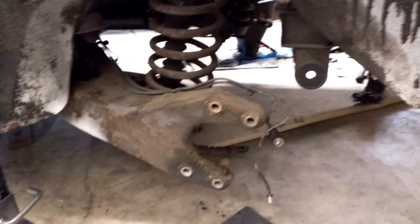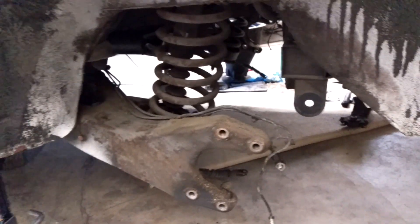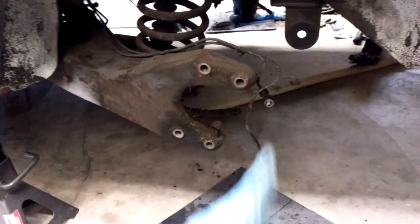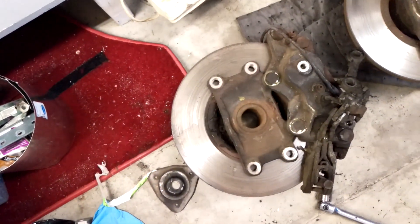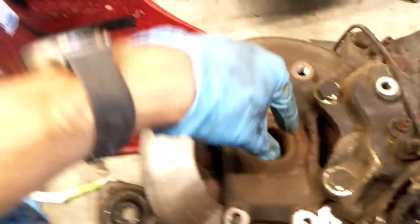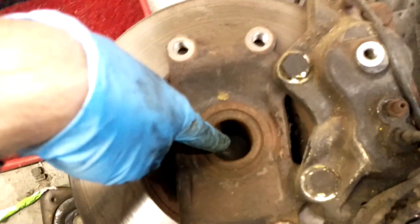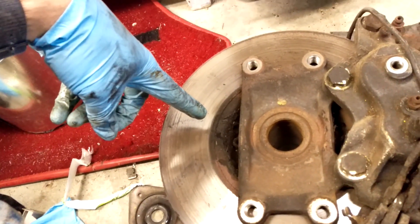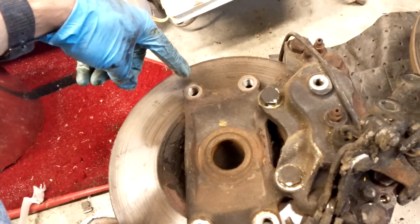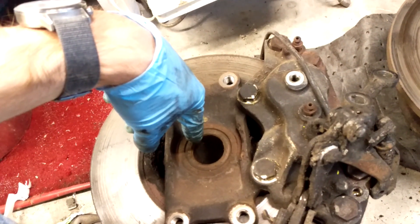I have the hubs taken off right now because I'm having the drive shaft machined for two extra woodruff keys, otherwise a single woodruff key is attempting to transmit all the power. There are the twin brake lines, and obviously the diff would mount to that giant carrier. Here are the hubs — brake calipers still attached. The yoke comes off for the U-joint, goes all the way through the hub, then bolts on with a crown-looking thing back onto the brake rotor and the face that holds the wheel with the studs. A crazy arrangement — all these beefy components and just one woodruff key.